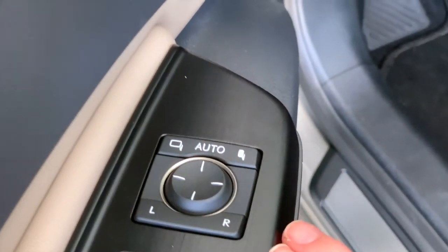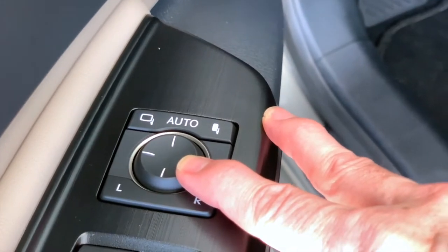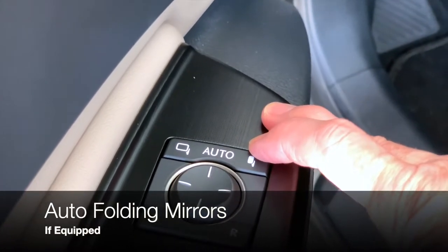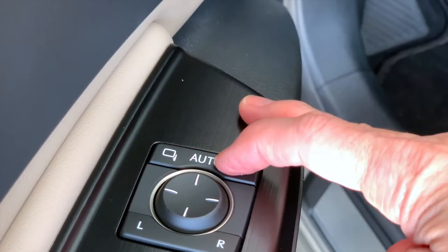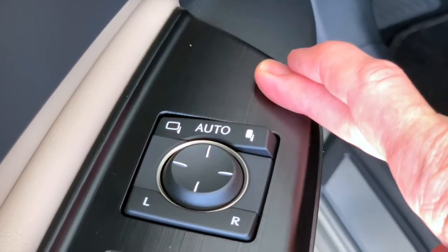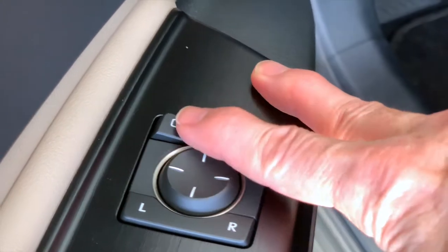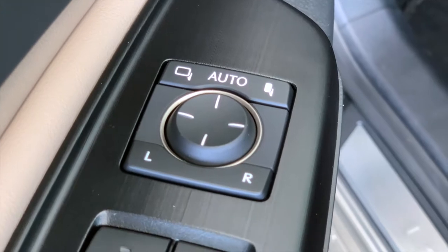You'll choose left and then right using the touch pad to make your mirror adjustments. If you have auto folding mirrors, you will have either a toggle or a button that has a light. If you have a toggle, it needs to be toggled to the center. If you push to the left, that will open the mirrors; push down and to the right, that will power close the mirrors. Toggle to the center and they will automatically close for you when you lock your ES.